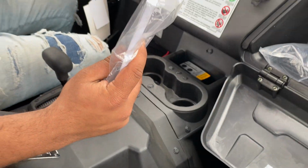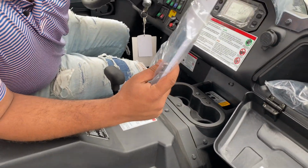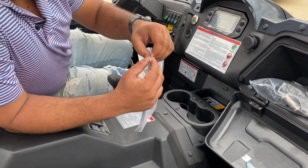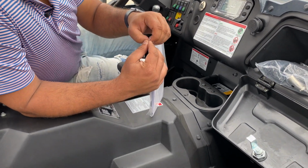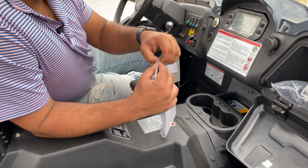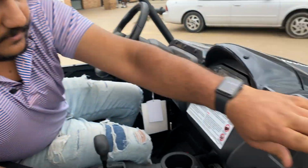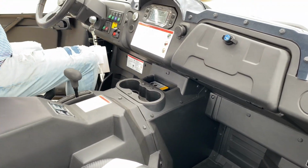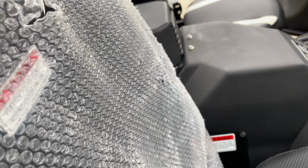It'll tell you about your oil changes, the filters, how often you've got to maintain it, what you as an owner have to do to maintain the vehicle. It's pretty standard. It takes 10W40 oil, and probably requires an oil change every 1,000 miles, and maybe an air filter cleanup periodically. So please do give it a read. That's really handy and useful information.